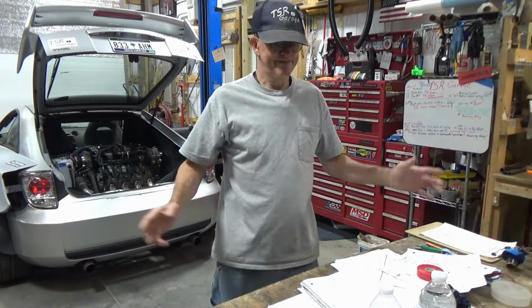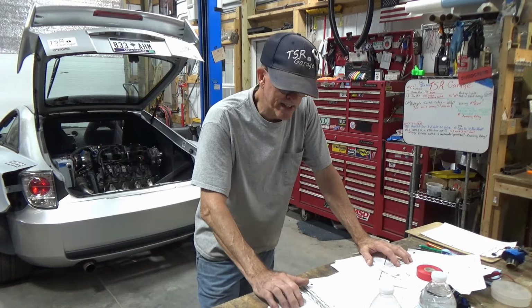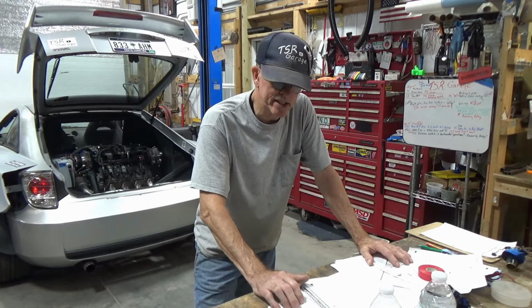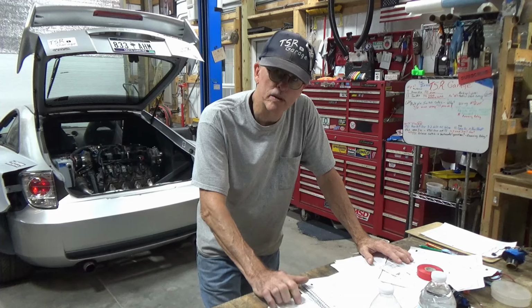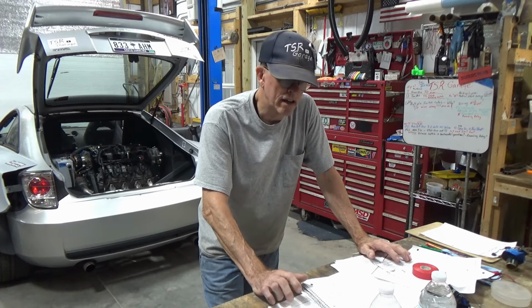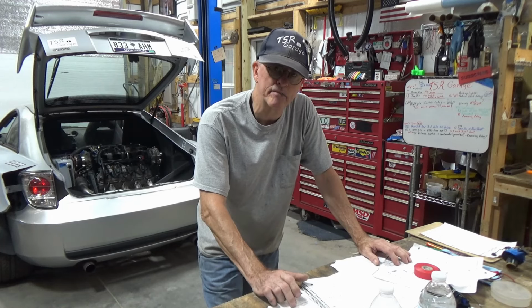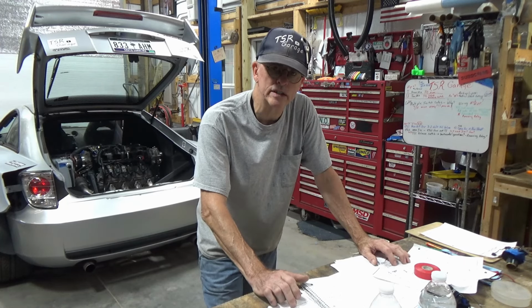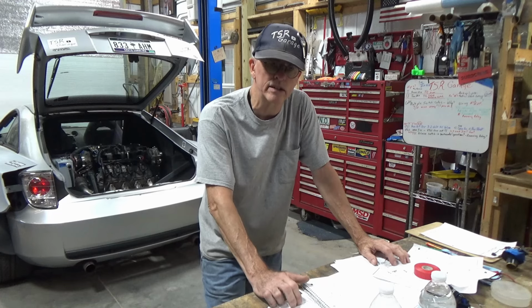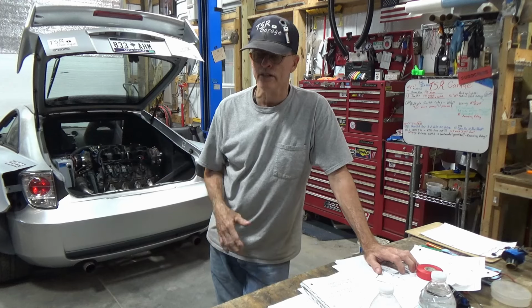Backup lights, I don't know. I haven't figured out exactly where that signal comes from. Everything is wired to the transmission correctly. I can't find an output signal off the computer that'll give me backup lights right now. The internal mode switch does not have a pin for backup lights or for an actual reverse signal. So we may just throw a switch on it somewhere else. My shifter does not have any switches in the shifter either. So I'll get backup lights somehow.